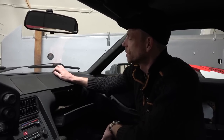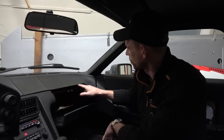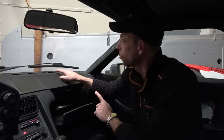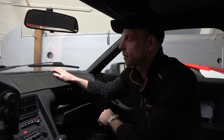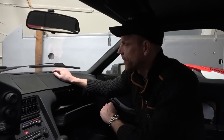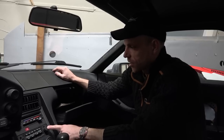I've heard that when you recover these dashes with leather and French stitching, you need to source the later Porsche 928 vent grills in plastic from a new-old-stock supplier, because apparently the later 928s were covered in leather and had matching vent grills. The radio doesn't work very well, so that's something I'll need to address too.